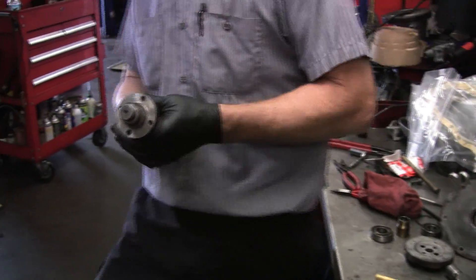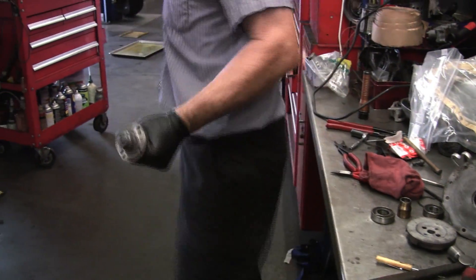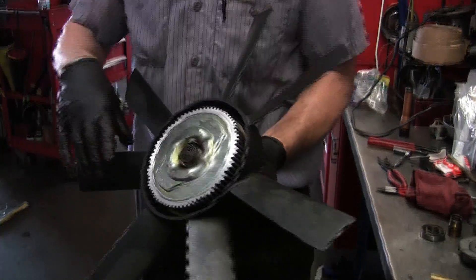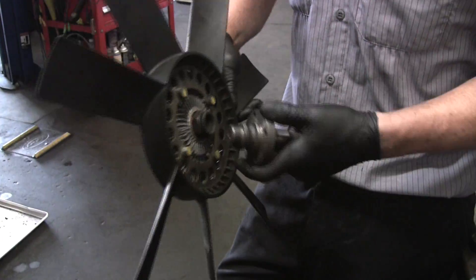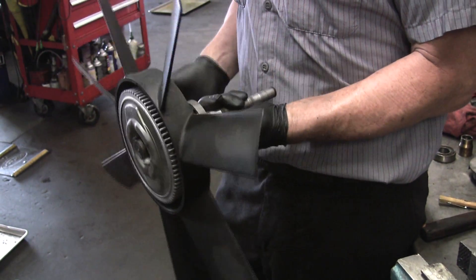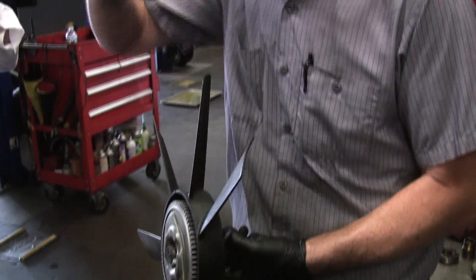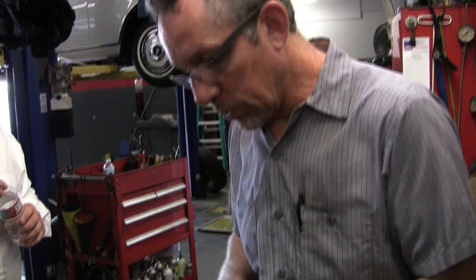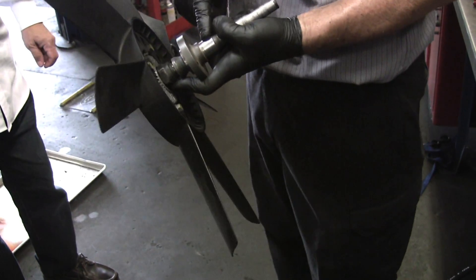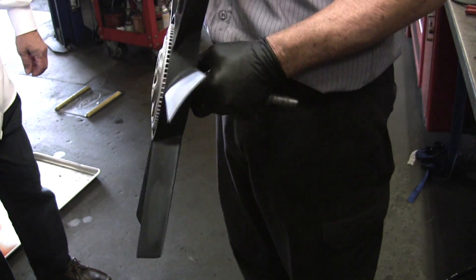One thing I'm going to mention for those of you who are going to try this: to take off the fan — the fan has a big nut — it has a fan clutch on it, which is temperature controlled, and it's got a threaded part, but it's left-hand threads. So to get it off, you have to turn it the opposite direction — righty-tighty, which is untighty on left thread. The easiest way is with an air chisel to knock it loose, because you can put a big wrench on there but then the pulley turns. I've done this thousands of times and it usually just pops right loose, and you can just spin it off.